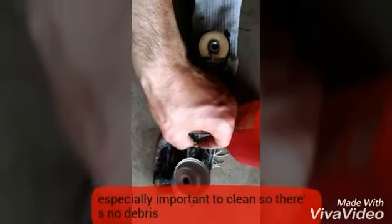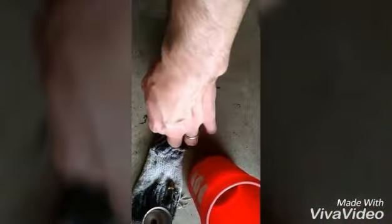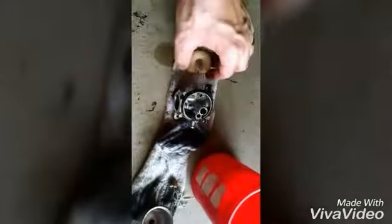It's amazing how holes that are so small will mess up your day. There are holes in the bottom of this — kind of hard to make out. I'm going to blow that out and hit it with carb cleaner. You can see the hole right there — it's a little obstructed with dirt and debris. I'll take the float off and get down into the jets and clean this out. I also want to pay attention to the gasket seal around the bowl itself to make sure that's good. Pull this pin out and then the float will come out, along with the needle jet below that, and down inside is the jet itself.